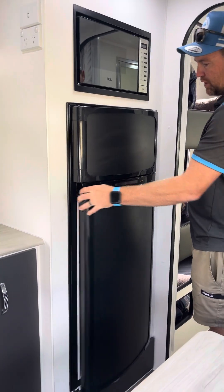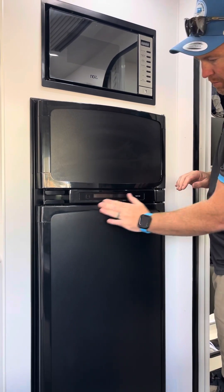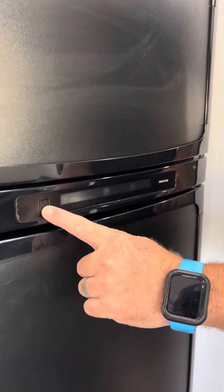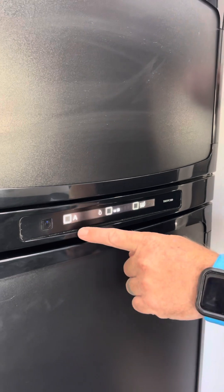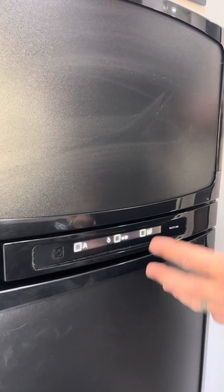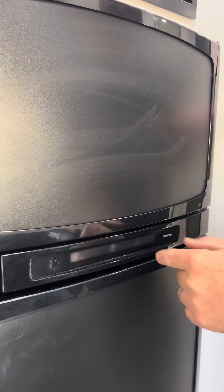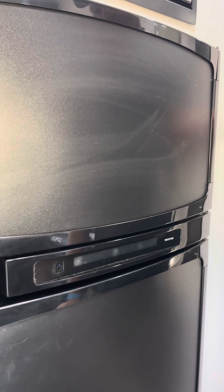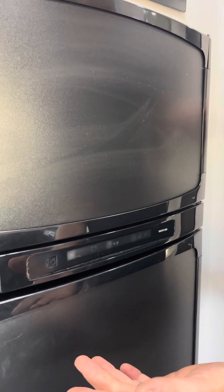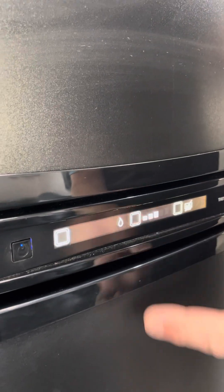Next along we've got a fridge-freezer with great space and plenty of room. These are quite easy to work - to show you how the gas works, you hold the power button for two seconds, it'll light up, and we leave it on automatic. What it's found is the flame, so that means it's running on gas - you can hear it ticking away. If you plug into the caravan park it'll automatically go to the power lead function and run off power. If you want to change anything just press that button - when it's flashing it means it's not working, and as soon as it gets onto a source it can find it'll start loading up and you can change your settings.